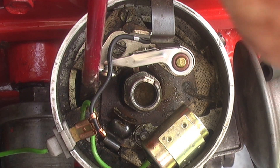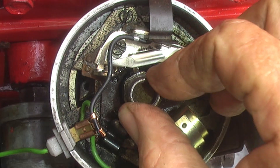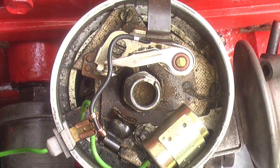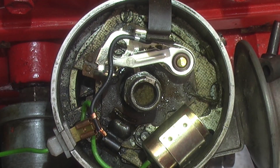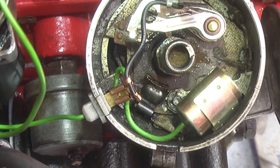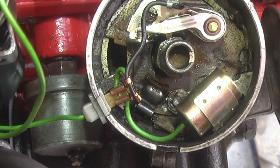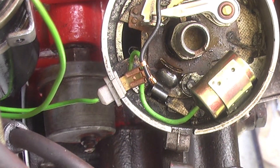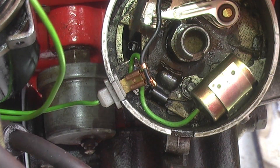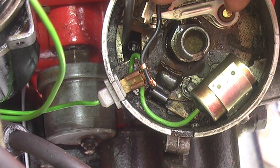In this little space in here we're going to see a little tag as we rotate this, and it'll have a spring attached to it. What we want to do is find the light one — there's two springs in there. There's the centrifugal advance in action, exactly how it works. We've got to find that little post. Let's rotate the engine. There's the spring — gotcha. I must have just missed that primary spring when I was turning it before.